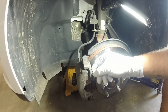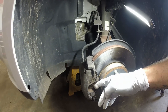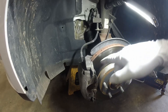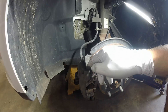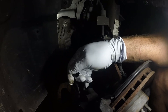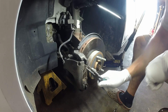Looking in here, we have these little clips on the front brakes. We have new ones in the kit, so we're going to pop these off — that helps us get the pads off and holds the caliper onto the bracket. We're not messing with the rotors; they look great, no ripples or anything. We're going to come to the back here and pop this little cap off. It looks like it's going to be an Allen head, so I'll find out what size and knock this caliper off.